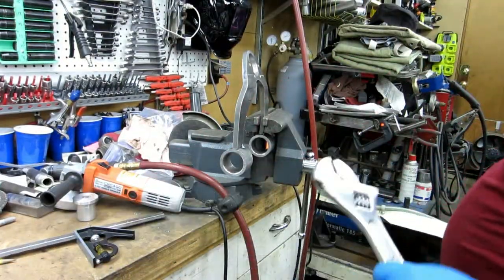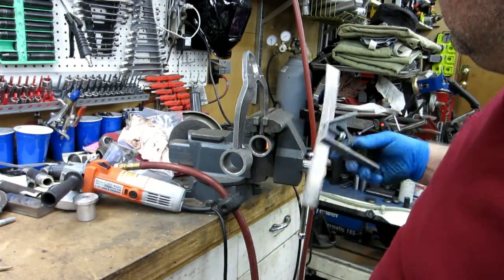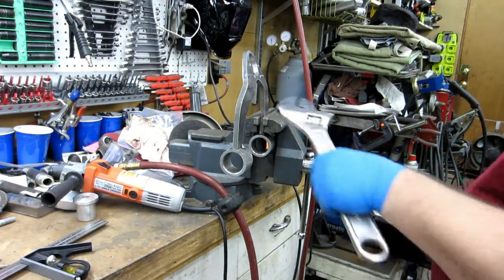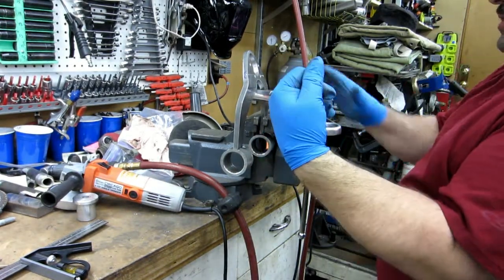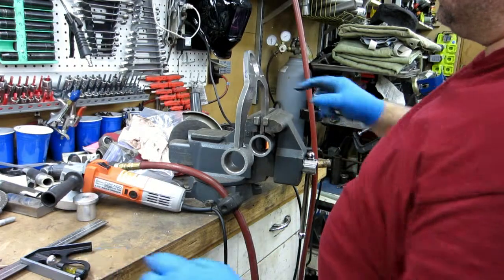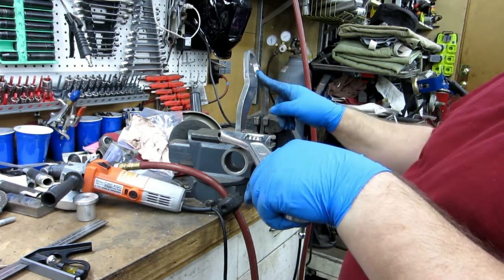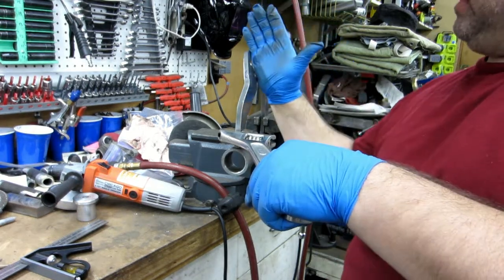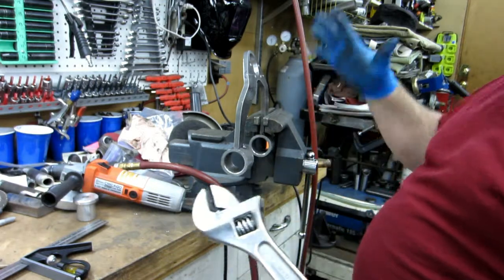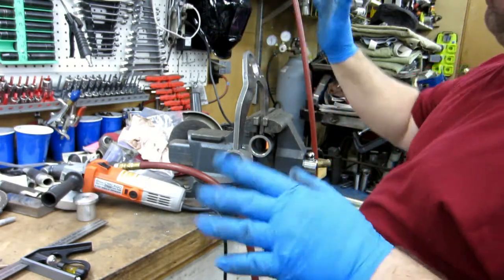All right, I got a 15-inch crescent wrench here. And basically what I've done is I've gotten it pretty close. I'm taking my ruler and going right here at the peak, and I'm really close. I'm getting rid of about half of it, but basically I'm putting it up here, and it's hard to get the vise not to swivel, and giving it a couple of yanks and tweaks there. Now, I don't really want to do it over here, because this is the thinnest part, and the metal here is thinner than here, and I don't want to bend around this axis. I want to bend it over here, because I want to keep this fairly flat for the ball joint. But this is prototyping and testing, and the more important thing is that I'm able to check this angle with the ball joint. So if it doesn't mount perfectly flat, that's okay.